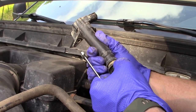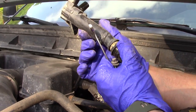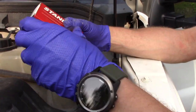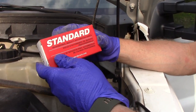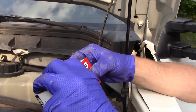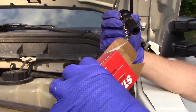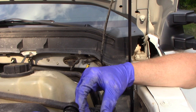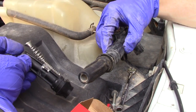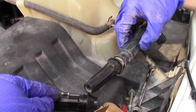The question is where is the spark jumping from, because everything looks in pretty good shape. This is serviceable — I was able to buy this part, standard SPP 139E, and I got it on RockAuto. It took a few days to get here; they didn't actually carry it at the local parts stores. So this is just a direct replacement for the boot, and it comes with the new conductor inside. It looks like some kind of resistor pill or something.